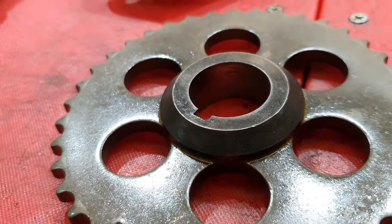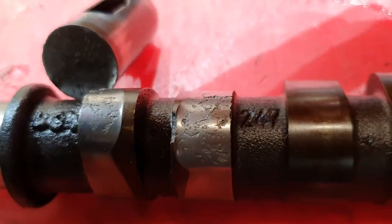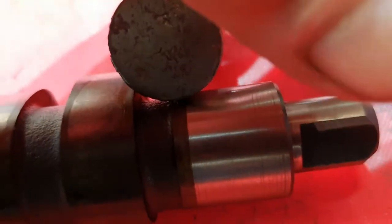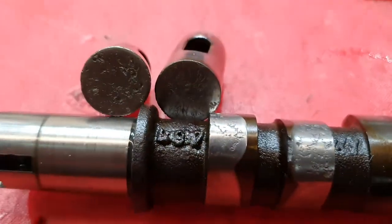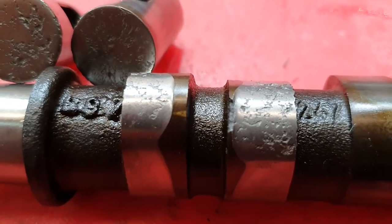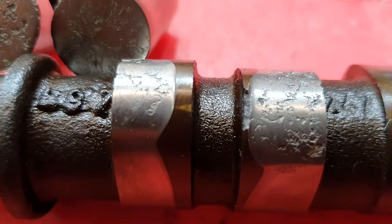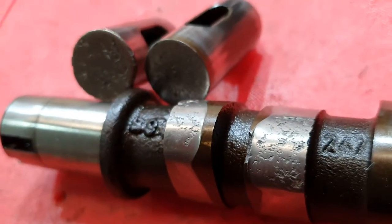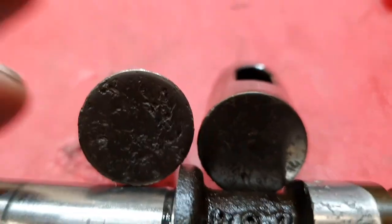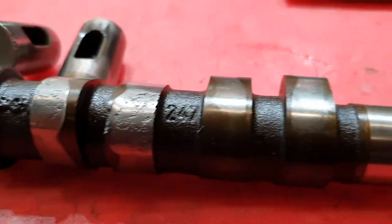Pretty good steel — makes a beautiful ring! That's one camshaft. Here's the other one — you've seen this before if you watch any of my videos. This came out of a bike that was just in for a reseal. These are the two exhaust cam followers, and these are the areas they run on. They have eaten where the camshaft lobe was — completely chewed to bits — they've got little mountains in them, and the lifters are actually hammered round on the edges. In my opinion this had been going on for a long time.